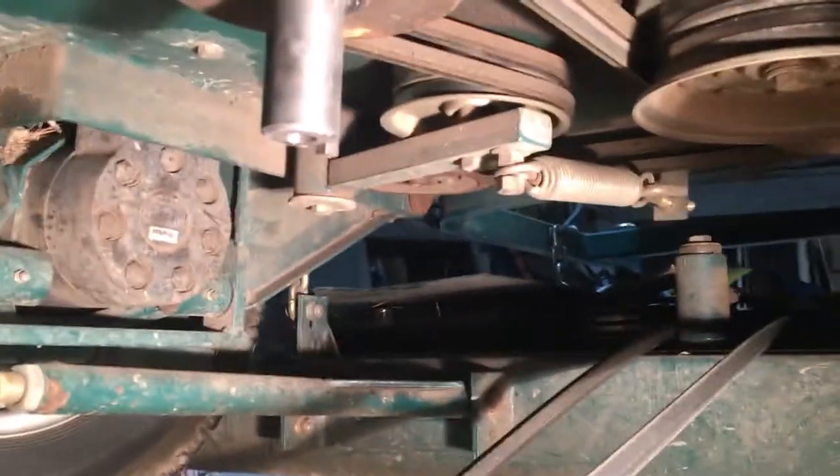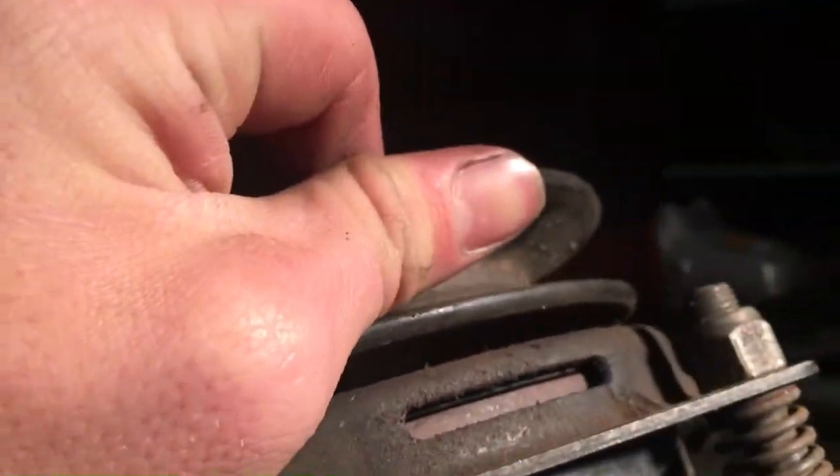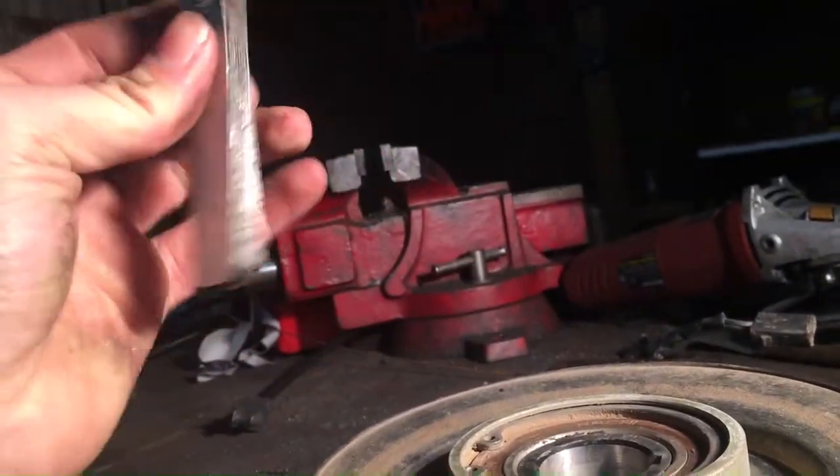It's really easy to change your belt when you have the clutch off. So let me show you one more thing about that clutch and wrap this video up. The last thing on these clutches is — see right here in this little groove — you can actually see there's a gap there. It's hard to see on camera, but you can see it with your eyes really easy. That gap right there, you need to look it up by manufacturer, but you need to take your feeler gauge and make sure it's set appropriately by tightening up the screws on the side. You gotta be real gentle with a quarter turn — it could be a difference of like ten thousandths.